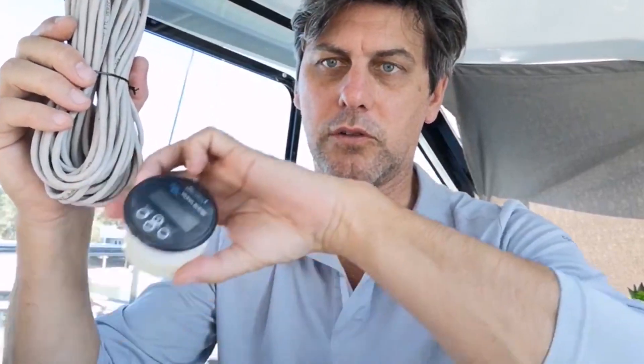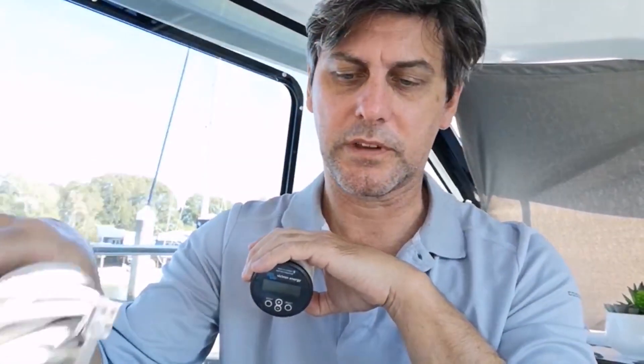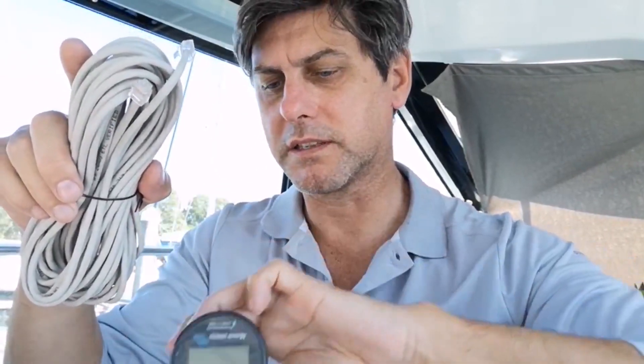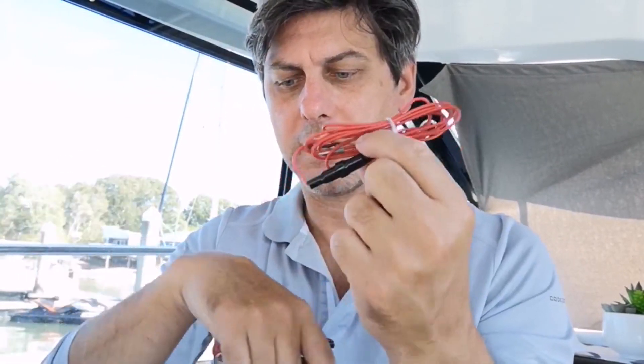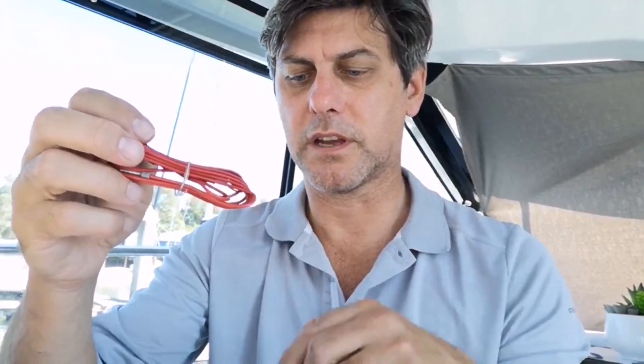There's a very long Cat5 cable - the shunt has to go right next to the battery terminals, then you run the cable to wherever you want your monitor to be. Some people just keep the unit in the engine bay because it is Bluetooth, so you could just use the app on your phone. These are the two sensors: one powers the shunt itself as it needs its own power supply, and the other goes to your second battery - usually the starter battery.